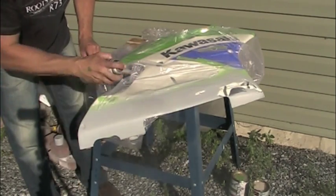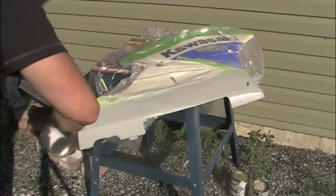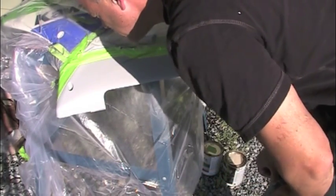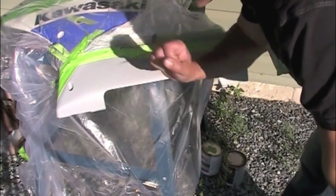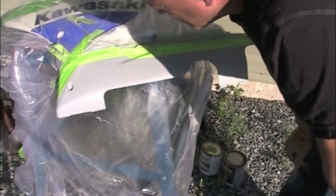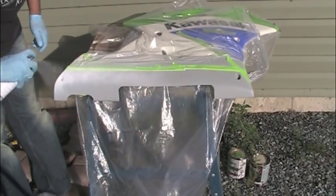Here we go — hopefully the first of the final prime. I make my first shot going with the tape so I don't shoot it underneath and to seal down that edge, and then I work my way down underneath the body and then direct on, 90 degrees to the panel itself. Now that turned out beautifully. One little blemish right there which I'll probably just quickly touch up — it looks like just a bubble of paint that went down. But everything else is perfect. It's all nice and smooth, just like it was molded in grey plastic, which is exactly what you want. This paint is very nice to work with — it settles down and spreads out quite nicely, and cures uniformly. I've retaped and remasked the edges and I'm ready to put down my base and color coat.